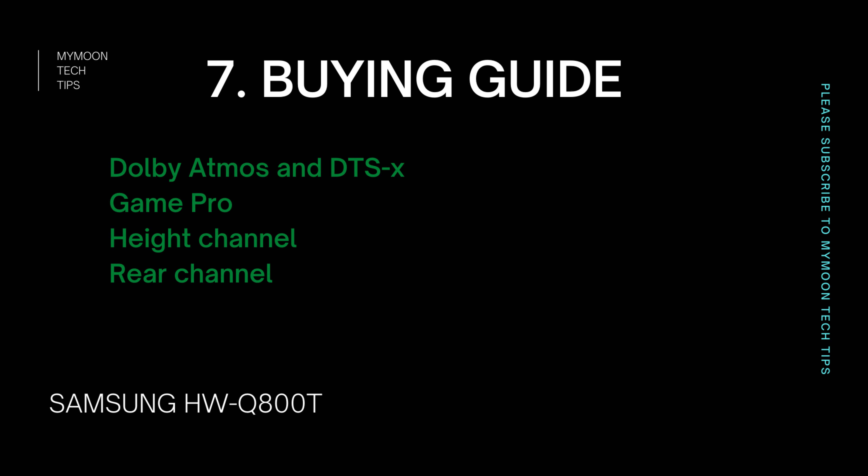When it comes to connectivity options, you can connect the soundbar in two ways: via HDMI or via optical. For HDMI, you can connect the external device directly to the soundbar and connect the soundbar ARC back to the TV. If your TV has an eARC port with Dolby Atmos support, connecting the TV's eARC port to the soundbar's eARC port gives you the true Dolby Atmos experience. Via optical you can connect the cable from the external device or from the TV directly to the soundbar. Using HDMI ARC or eARC is recommended over optical for full immersive and surround sound experience.